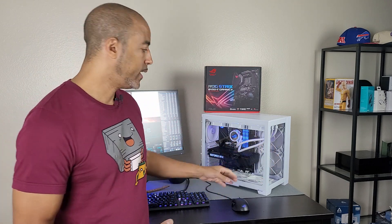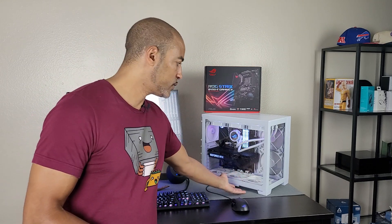Right now I have two 140mm fans by Arctic blowing air into the case, and three 120mm high static pressure fans sucking air from the bottom and blowing it into the case directly at the GPU. Then I have one more as exhaust, and up top is the Asus 360 AIO wide edition. It's been performing quite nicely, especially after managing all of the fan curves. This case is now basically whisper quiet on full load.